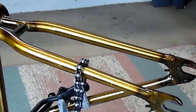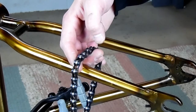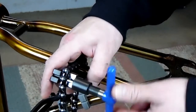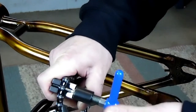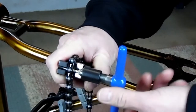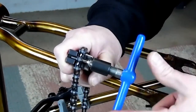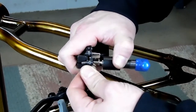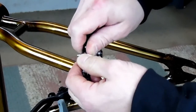After that, I'm going to remove the chain because it has to be switched to the other side. For this, we need a chain tool or chain breaker. I have the Park CT 3.2, which allows the plate on the bottom to slide all the way against the block. Other chain tools, like the Odyssey, have a block that screws inward against the chain, which is also good. All you're going to do is push the pin through. I like to leave it hanging just a little bit so you don't have any loose pieces, and positioned just to the inside so that when you put it back together, it hooks into itself and stays — so you're not trying to hold two things at once while putting the pin back in.